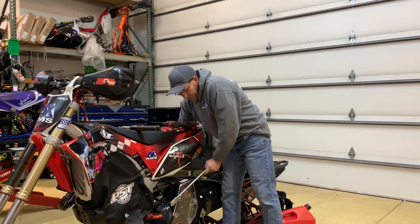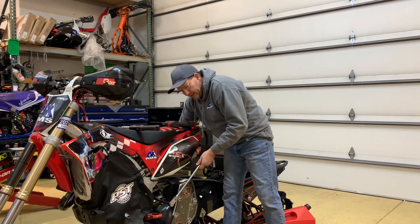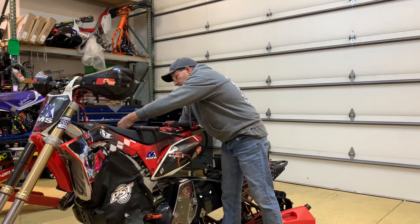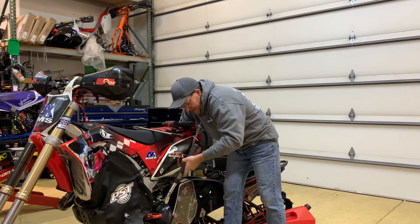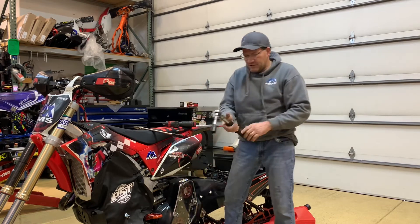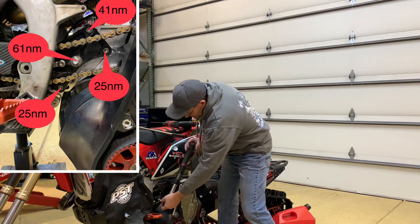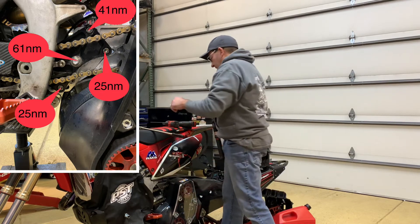Move ever so slightly — you can go from a loose chain to a tight chain in just a couple degrees of these ratchets. This thing doesn't move very much. What I'm doing now is holding the eccentric bolt with my other ratchet on the other side while everything's in place. Then I simply tighten up the eccentric holding nut on this side, let up my pressure, and set my torque. The center eccentric bolt is set to 61 newton meters. That nut is now set to 61.